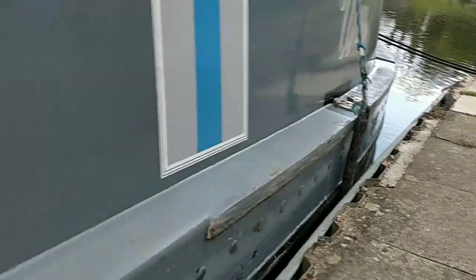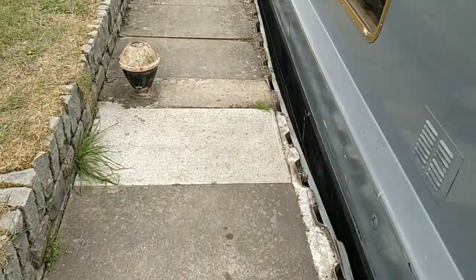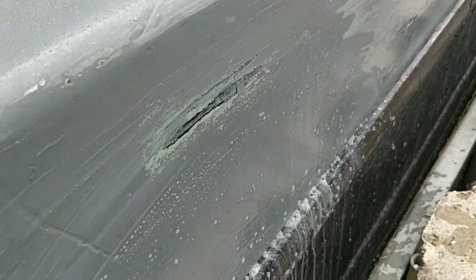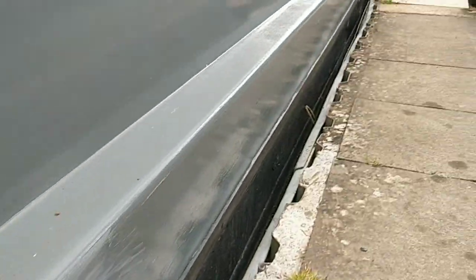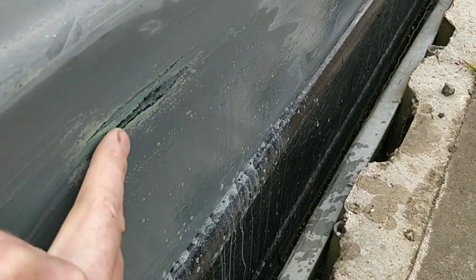Hard standing, which is fabulous. Perfect time to do it. As you can see it's coming off alright — 400 grit paper, a bit of soapy water. I'm just going to wet and dry all this side here. It's coming off quite quick; that's probably five minutes of work.